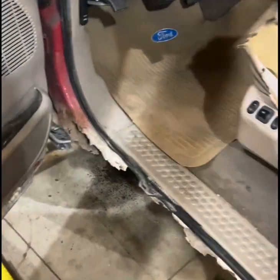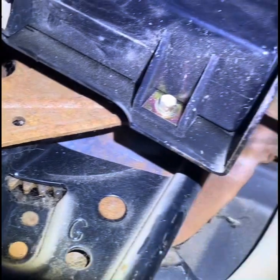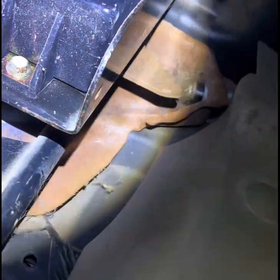Come inside your truck and pop open this panel right here to get a little more room. You really don't need it out of the way, but it definitely helps, especially if you need a flashlight to see what you're doing. Go ahead and get that out of the way. You're going to come in here and these two little 8 millimeters — you got to take those out and then unplug your PCM and it should come right out.